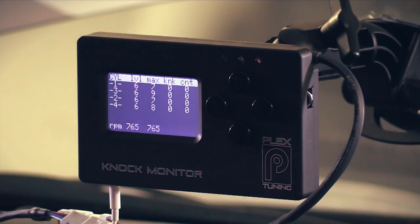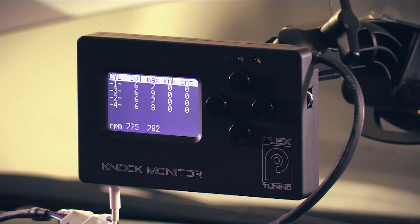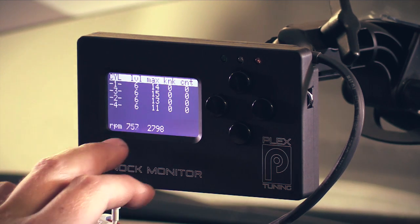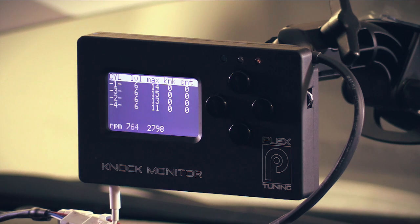In the monitor screen, we've got this unit set up for individual cylinder knock detection and we've got a screen here which shows our individual cylinders as well as the current level of knock we're seeing from each of those. Beside this we've got our max knock level that we've seen while the engine's been running and if I rev the engine we can see that that jumps up. We've got RPM and maximum RPM down the bottom and then we've also got our knock count so we can see which cylinder's been knocking and how much it's been knocking.